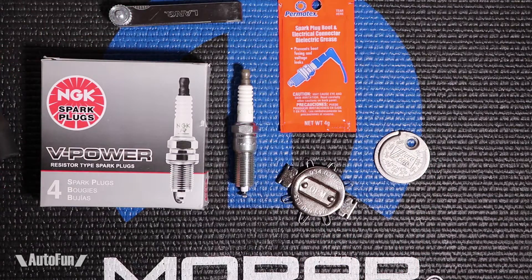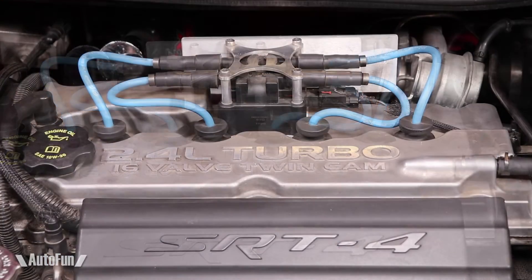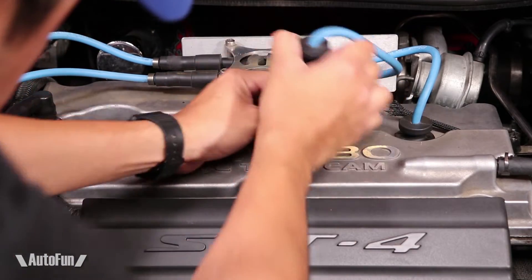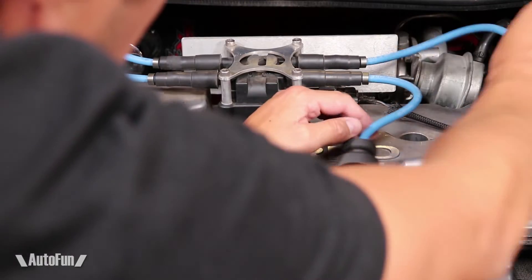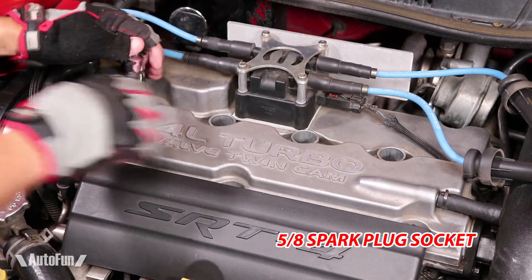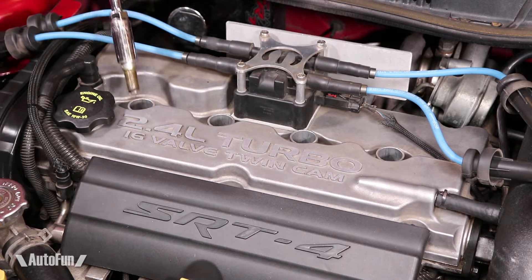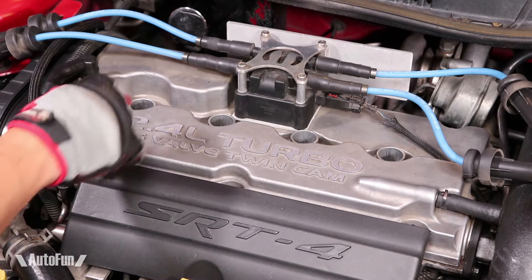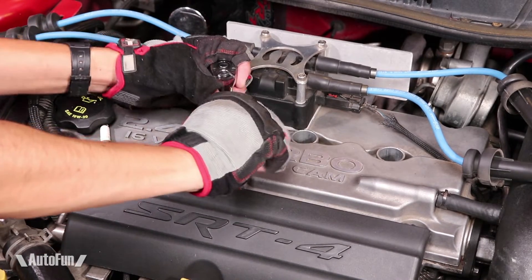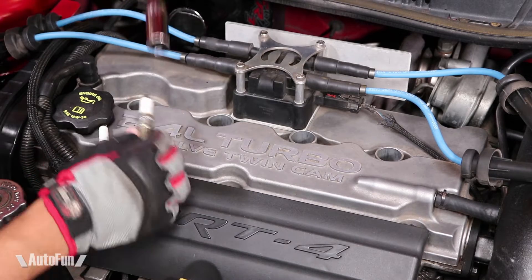Now that we're done looking at this on the desk, let's go look at how it looks in the car. I like to start by cleaning this area with compressed air — this ensures that nothing's gonna fall in once I remove the spark plug wires. Carefully I remove each spark plug wire, pulling on the grommet not the wire. To remove the spark plugs I use a special spark plug socket. As I take the spark plugs out I'll line them up so I know where they came from. This is important because I'm gonna inspect them — if there is an issue I'll know exactly what cylinder has the issue. I'll put a link in the description to a video that shows the different things that can be observed when inspecting spark plugs and what they mean.